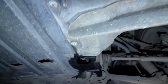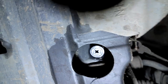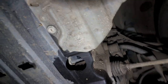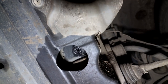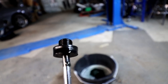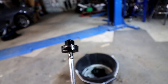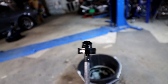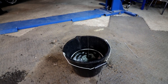Draining the coolant is quite easy — there's already a cut-out for the draining plug so you don't have to take anything off. That's your plug; you need a Phillips screwdriver, quite a big one. Undo that and it's not too tight because it's only plastic. Once you've done it, catch all the coolant in a clean bucket if you're reusing it, or use this opportunity to replace the coolant if it's been in the system for five years or more. It's a plastic screw with a rubber ring — don't lose the rubber ring as that's what seals it properly. It takes about two minutes to completely empty the system.